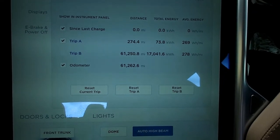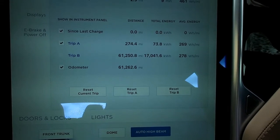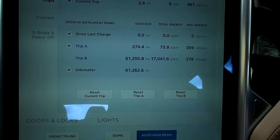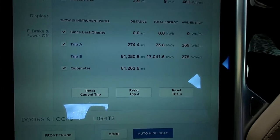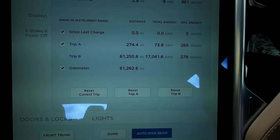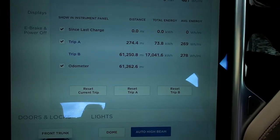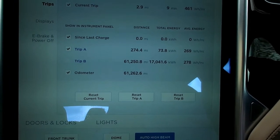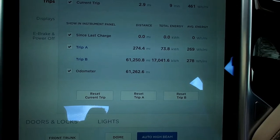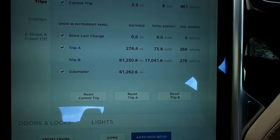This probably arises because my battery may have slightly higher internal resistance due to continued fast charging, such that if we charged at the higher 115 kilowatts, it might cause excess heat from that internal resistance, which as we know is detrimental to battery life. So I suspect that's what happened. In actual reality, I only ever saw 115 kilowatts for about five minutes, so dropping to 94 kilowatts is no big deal.